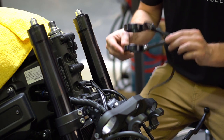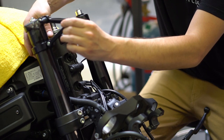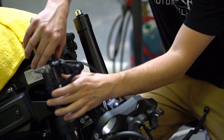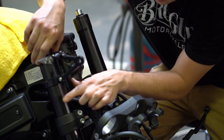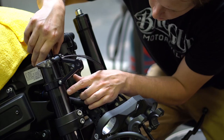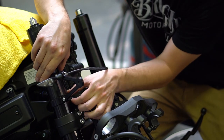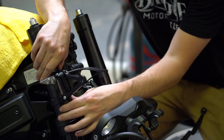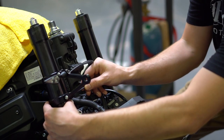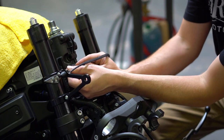Take your headlight bracket and slip it over the fork and bring it down. You might notice — easier to see up close — there are machine lines with an edge down to about here. You want the top of the bottom bracket to be even with that edge, so it should look something like that. Next just snug this up, keeping it pretty loose right now because we're going to adjust it later.